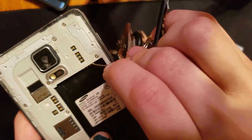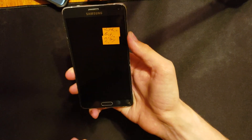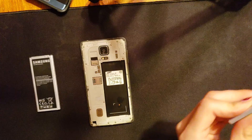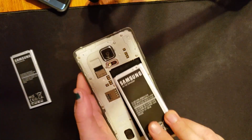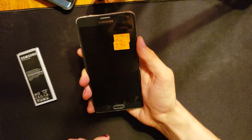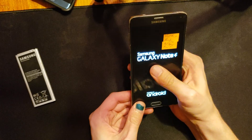Once I did that it was just kind of bent a little bit still, so I put the original battery back in and tried to power it on — it didn't do anything. But I have another Note 4, a Verizon variant with a busted screen, so I took the battery out of that one. It's actually a knockoff Chinese battery — it looks horrible — but it's just a test battery, no big deal. I pushed it in, and presumably this battery is a little tighter than usual OEM batteries, so it ended up reseating that pin. I hold the power button and then boom — Samsung Galaxy Note 4 booting up.